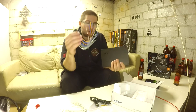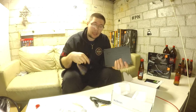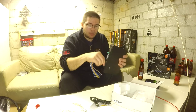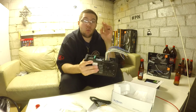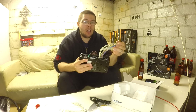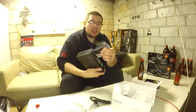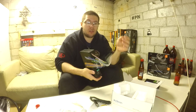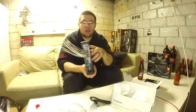The input channels are, I think actually there were 4 input channels: front left, front right, back left and right. You put this plug here and connect high level or low level inputs here, and a wizard or an audio technology guy can solder RCA plugs in here. Audison also sells a plug here, so you can have RCA females and plug in your aftermarket head unit and use this as an amplifier, or a DSP and amplifier, with a subwoofer output also.